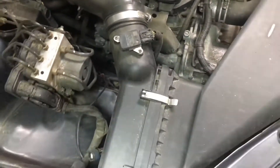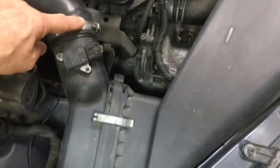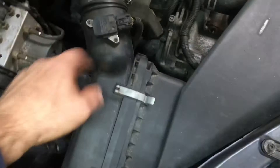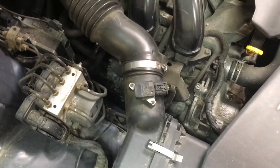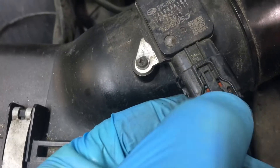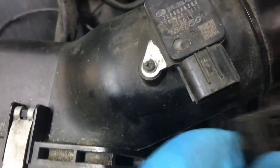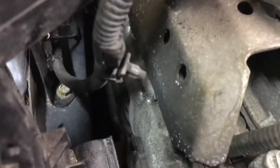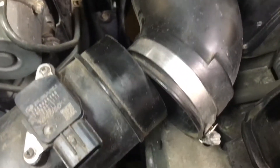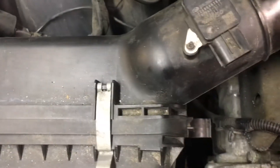So we're going to remove the air cleaner over here. This little clip here — the cover — to get a little more space, and we'll come back in a second. Push down on that clip and pull this off. With a pair of needle nose pliers you could pinch the little tabs on the side to get this wire out of the way. Unhook the little hose here and now the whole air cleaner can come off.